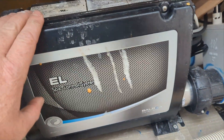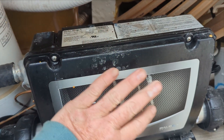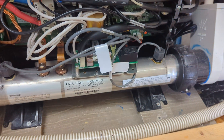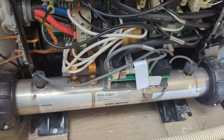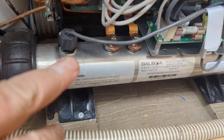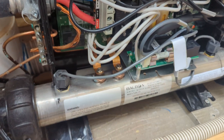For this pack, you find the pack and take the two screws off at the top — or whatever pack you have — and take the front door off. You look for any burn marks. Normally, 90% of the time, it's going to be the element. This is the one with the copper bands. I can see it's sort of discolored — it has a yellow tinge to it.